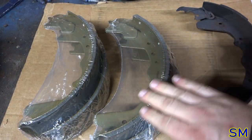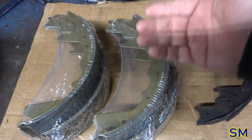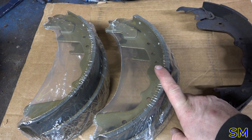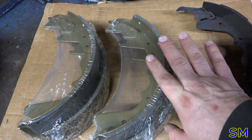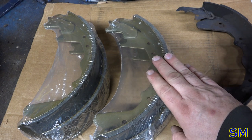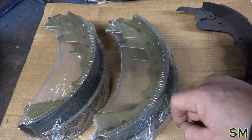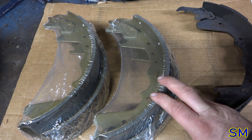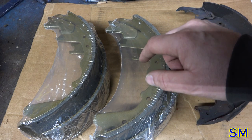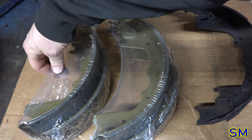So, as to why the secondary shoe is going to have a lot more meat than your primary shoe, basically one side is going to wear faster than the other. And to explain that physics, it's actually better for me to hand that portion of the explaining off to Jeff at Elderly Iron. He doesn't know I'm going to link his video, but it's an awesome video. It takes about 20 seconds. It would take me about 3 minutes of fumbling about. He explains it all 100% better than I ever could. So the link for that will be in the description below on my channel, including the timestamp. Crystal clear and to the point. So if you want to know the physics, pop over on his channel with a video I linked down below. So let's go ahead and put some new slack adjusters on our secondary shoes. Or brake adjusting lever, whatever.